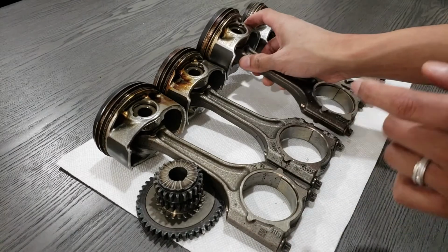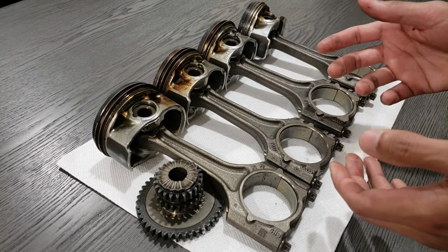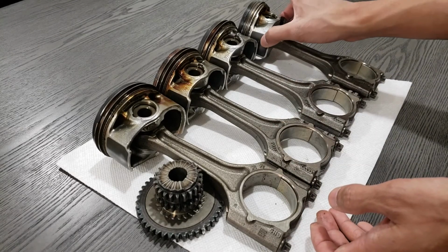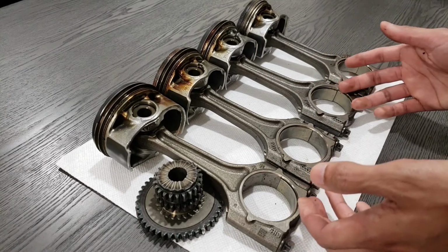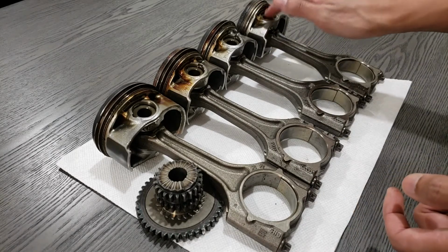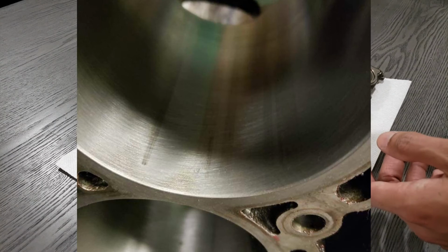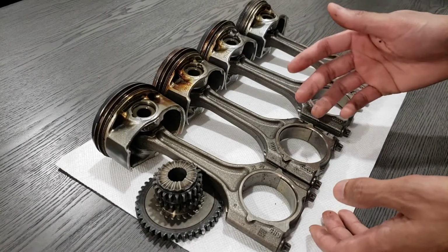So basically I had no compression in there because the seal was basically gone, and oil was able to freely flow through it, no problems. And yeah, so no compression, car ran like crap. And I'll link a photo of the cylinder sleeve for this cylinder 4. You can see here that there was some light gouging and scrapes along the side. So with an engine rebuild, you have to get that fixed.